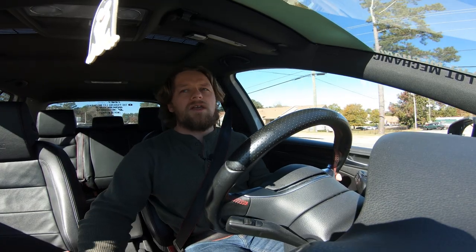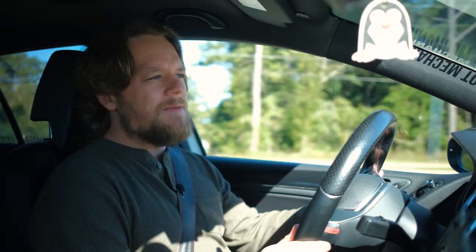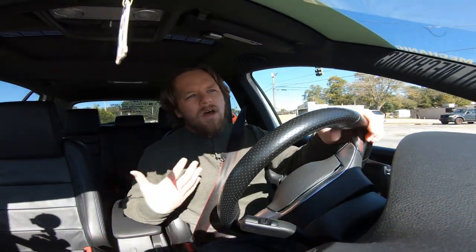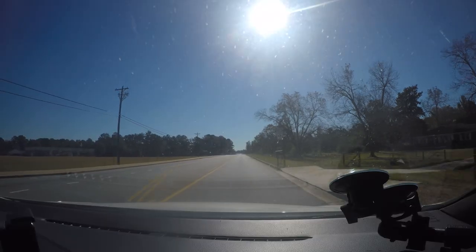So I did some research, and ECS makes a kit to fix this. The reason subframe clunk happens is two reasons. One, age and the stretching of the bolts that hold the subframe in place, and two, when you stiffen the chassis. My car is about 8 years old now, and I just stiffened the chassis, so both of them are happening at the same time. That would exacerbate the age of the bolts when I put the rear sway bar in, so that's why the clunking started to happen then.